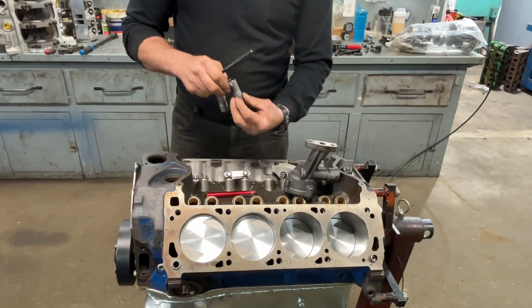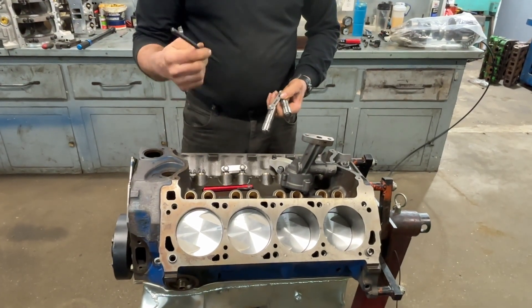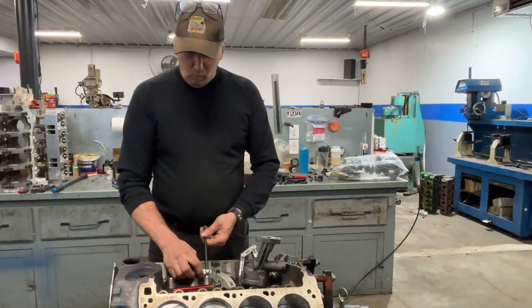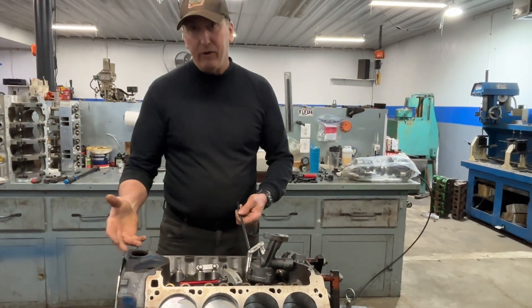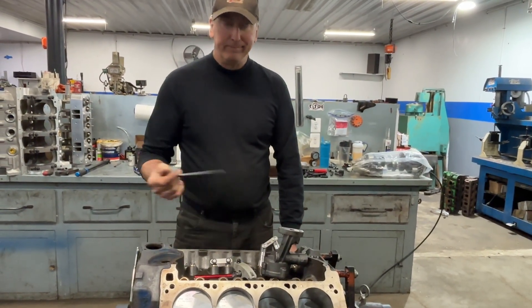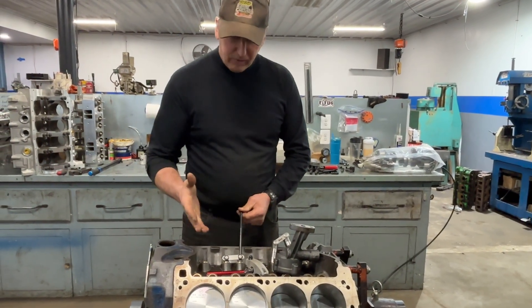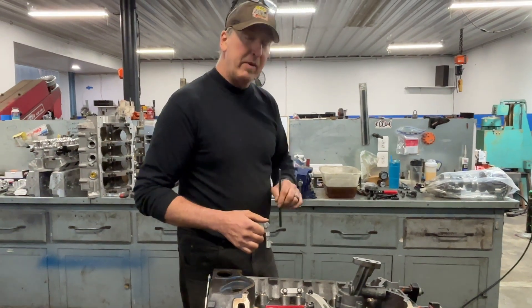An oil-restricted pushrod does nothing for you because the hydraulic lifter has already done its job to meter the amount of oil it's going to spit out here. It hasn't metered out the oil that's going to leak around it, but it has restricted the amount of oil going into the pushrod. In my opinion — you can put whatever opinion you want in there — an oil-restricted pushrod does nothing for the engine because well over 50% of the time you have valve lash. Because if you didn't, you wouldn't have any compression, and the thing's not running anyhow. So with oil-restricted pushrods, we don't use them, don't promote them, don't sell them. If you're trying to avoid fixing your engine or the oiling system, that may be a method for you, but fluid dynamic-wise, it doesn't work for us.